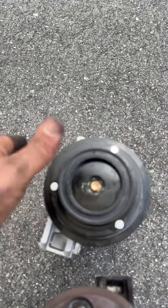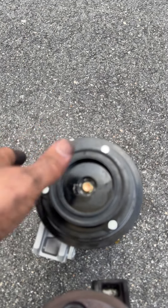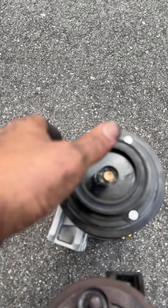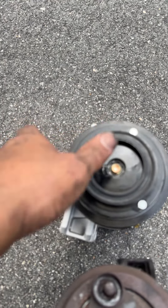You can get your hand on it — jack the car up, go to each one of the pulleys except the crankshaft, you're not going to spin that with your hand. But if one of these are locked up — alternator, water pump, whatever — you're going to keep breaking your belt, guaranteed, as soon as you start the car. This is just a mechanic tip. If you like these videos, please like, subscribe, and share. Thank you.